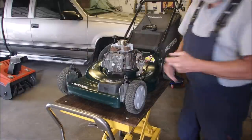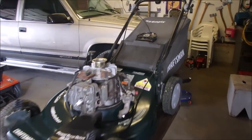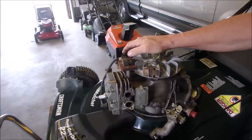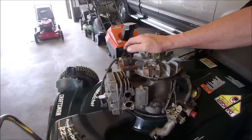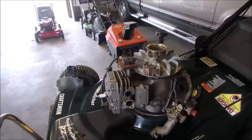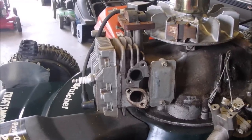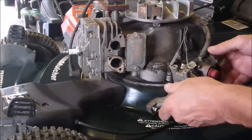So, on Tecumsehs, there's a couple of things that people hate about Tecumsehs. Number one is that you could almost change the flywheel key on every one, and that will improve how they start and perform. And the other thing is, people don't like the linkages